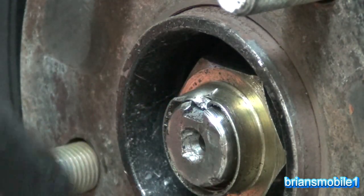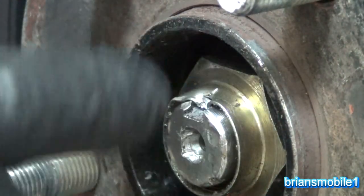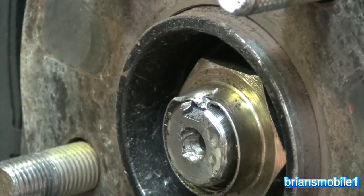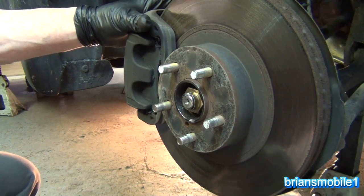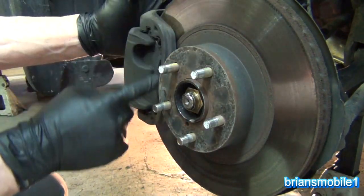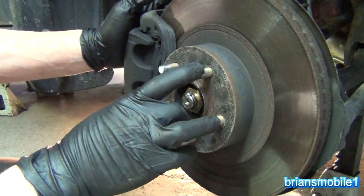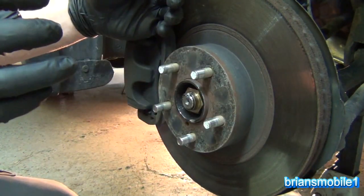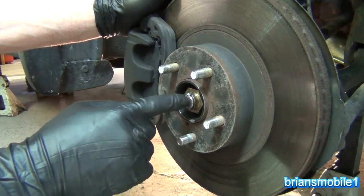This is like the safety backup device — if you don't do this and it works loose because your bearing's getting old or whatever, if you don't have something retaining it, it just comes off. Then the whole steering knuckle comes apart, the rotor starts to wobble, and it causes your brake response to be bad. With the rotor going back and forth it opens up the caliper beyond what your master cylinder can compensate for — you won't have brakes, steering control will be minimalized. Basically the only thing holding your wheel and rotor together is the CV axle spindle and the spindle nut.